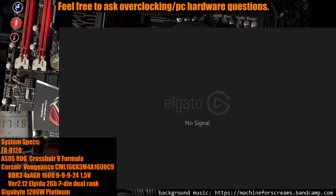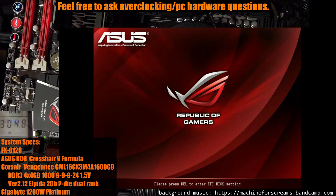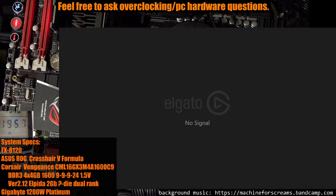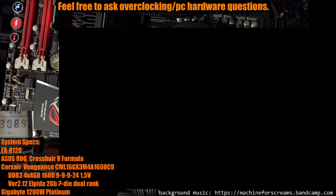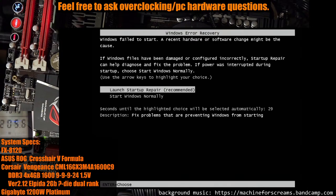What? No, Micron, no. Best DDR3 is like, you have PSC, X. There's Elpida chips that are really good, like Hyper, which I'm not sure what die that is. Then you have Samsung 2 gigabit D-Die, 1 gigabit G-Die. Hynix CFR 2 gigabit, as far as I know, is not completely terrible, but not on par with the others. Hyper is a variant of A-Die. Okay. Yeah, that's what I figured. I thought it was base Hyper. And regular base is not very good, and base Hyper likes to die for no reason.